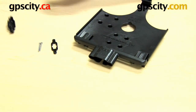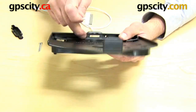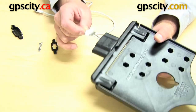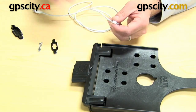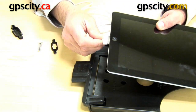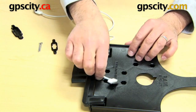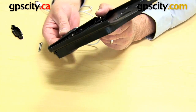The next step — or the first step if you're not using zip ties — is to get this connector into the slot right here. It's important to note this connector has a little grey symbol on the front showing you the front of the connector, so that needs to match the front of the cradle. You can't put it in the wrong way. This cable goes this way, and if you have an iPad you might want to double check that everything's right — the grey part has to be at the front, then it will connect into the iPad. Now I know which way is the front, so I have to slide it into the bottom and get the pins to come out the slot.